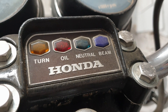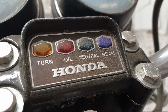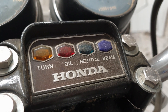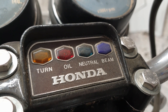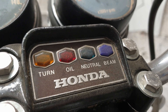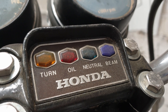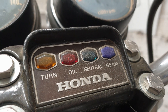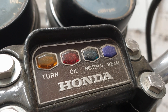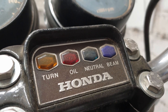This bike's warning signals only has one light for the turn, but the harness I'm using is from a bike that had a left and a right warning light. If I just join the existing wiring to this one light, what happens is the power passes through and causes both to light at once, which is not what I want. So what I'm going to do is arrange a little bit of wiring so that whichever way we're turning, that one light does come on.